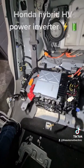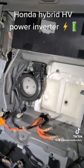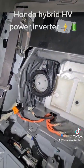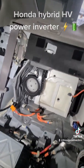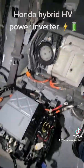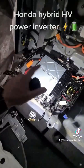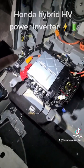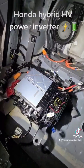There we go — there's our unit that's out. Now there's half your problem right there. A lot of the time on these Hondas, as with all hybrid and electric vehicles, cooling is a major part of battery health. That's why these units fail — those fans block up and are very problematic, so they always get replaced whenever any of this work is done. We'll be getting that out later. There'll be another video coming out on stripping this down on the bench and getting to the MPI, which is right at the back. Four bolts, all the plugs and wires — we're good to go.